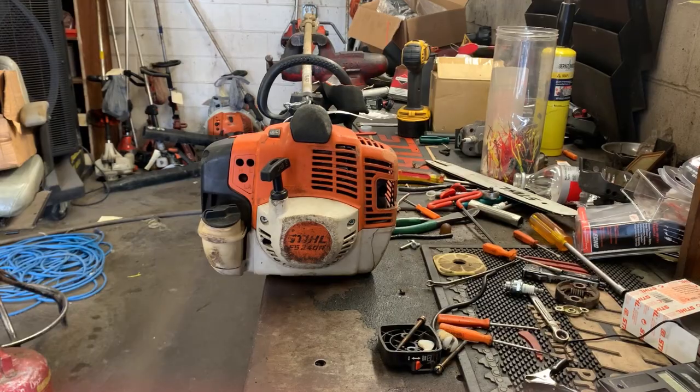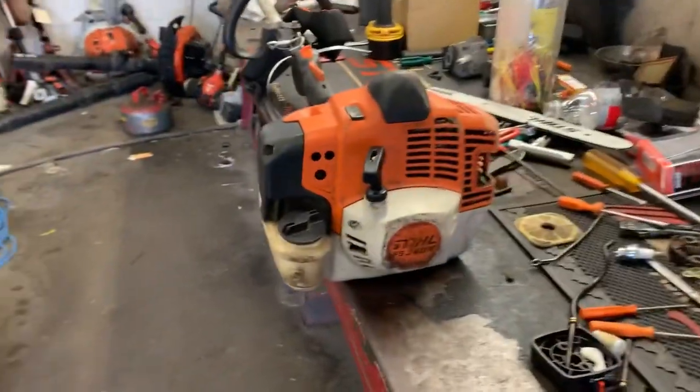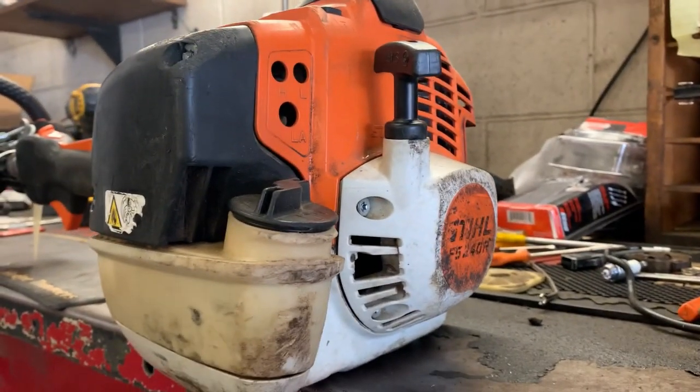That's an Echo starter handle on there so it doesn't fit down in there perfectly, but it is what it is — it's what they brought me to fix it with. Alright guys, we got the starter rope fixed on the big block Stihl. Starter repairs on these are daily because of the compression — it's so much that it ought to have a compression release, though I've never seen a compression release on a trimmer. The Stihl FS 240 — get you some! If this helped you out give me a thumbs up, smash that subscribe button, and click the bell so you'll get all my new videos. Y'all have a good rest of your day — More Medic One.